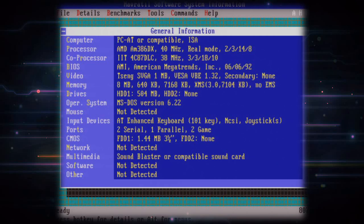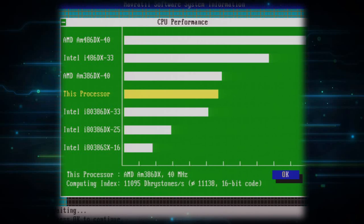I'm going to run the Intel at 40 MHz. Overclocking is not a practical solution in my opinion — just try overclocking a server or rack station and you'll be laughed out of your workplace very quickly. Keep in mind this CPU is now running at 121% of its rated speed without really complaining about it and no voltage increases. Try doing that on a modern processor. This shows there isn't much difference between the Intel and AMD solutions, though the Intel runs cold at either clock speed.